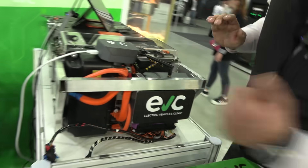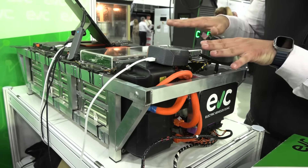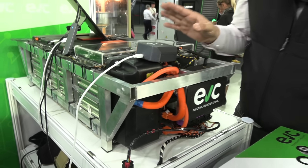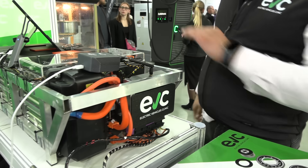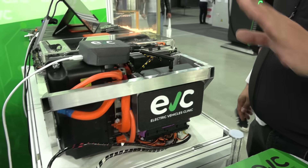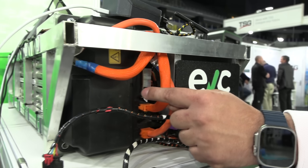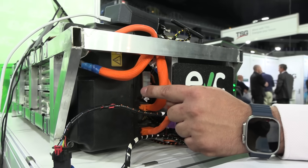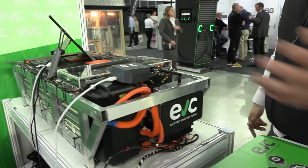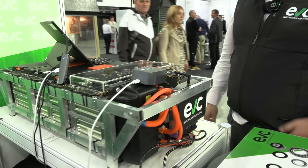Inside there is, for safety, one fuse, two contactors, and pre-charge contactors. So if anything happens inside the battery or inside the vehicle, the system will disconnect itself because it sees something unsafe. The purpose of this box is primarily safety. But what is interesting — we reused this, which is the safety box of the BMW Hybrid. We have 50 pieces on stock, so we were trying to find a way to recycle them, and we reused them inside our system. We are using a BMW S-Box for the purpose of this battery range extender.